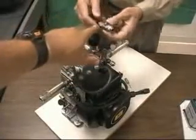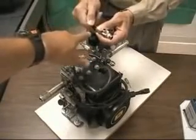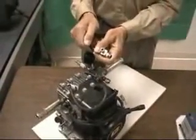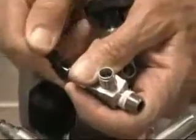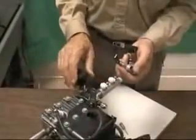Then we hit this one, which is the full feed valve — it's variable too, you can control it. It goes all the way from idle or off, where the idle valve is carrying the fuel, to much larger flow — maybe ten times as much flow for acceleration and high-speed running. If you open this all the way up, it goes to wide open throttle. You can put this on the foot feed and use the other as a stationary idle control.